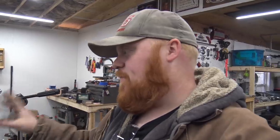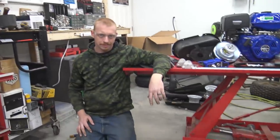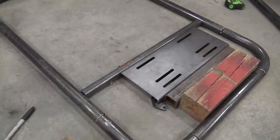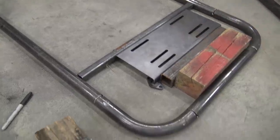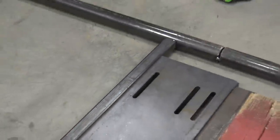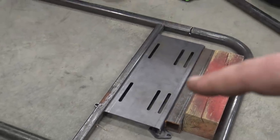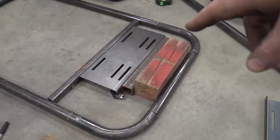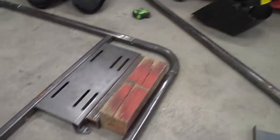We're getting pretty close on this rear section. Like I said, it's going to be crazy wide compared to the go-kart, but it's going to work out great. This is supposed to be a crazy awesome go-kart, so I think a huge rear end will make a statement. Old Brandon has been cutting and welding this round tubing — inch and a half — and we took some one-inch square tubing running alongside the engine plate, using some exhaust flanges from Go Power Sports as spacers, two on each corner of the engine plate.